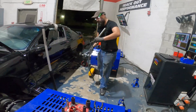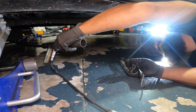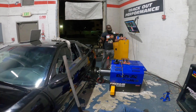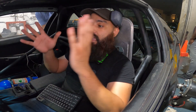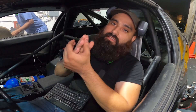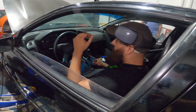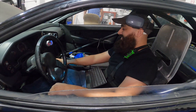He's going to hook up a little wideband to the dyno. Oh, it's not even that far back. Just because you can drive it on the street doesn't mean it's a street car, Fred. It's got a tag on it — it's a street car! It's at drive speed so that the dyno is matched with the car so we have the same data on the ECU. We look at 3000 RPMs, we're going to see the data at 3000 RPMs and we're at the same AFR, the same boost and everything. What gear are we going to do the pulls in? Since this is an automatic car, we're going to do it in second gear.